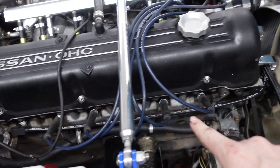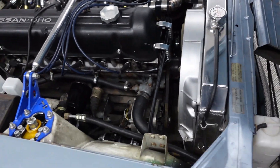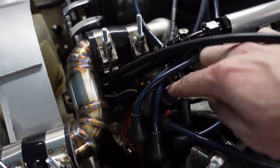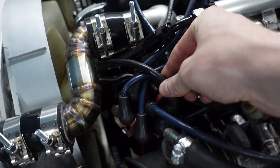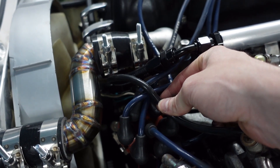Go ahead and plug it into the sixth cylinder, then run it across and match it to the distributor, and we take a measurement, cut our wire, and start putting together the fitting. I've got this run really nicely along the engine into my mounts, so let's go around to the distributor and I'll show you what's next. I just took one of the blank terminal ends and stuck it in the six cylinder part.